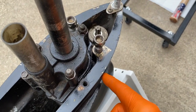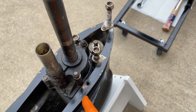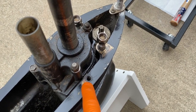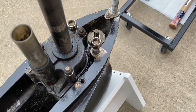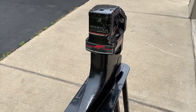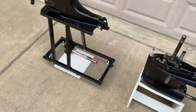If you ever see oil leaks in this area when the upper unit is connected to the lower unit and the outdrive is on the boat, chances are this o-ring right here has given way — dry rotted, cracked, or whatever — and it's allowing oil to seep out. We recommend getting that fixed ASAP, because if the lower unit is not feeding gear oil to the upper case, it's lights out — game over for those upper gears. So those are very important things to cover.